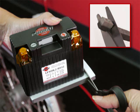So, in this case, we only needed to shim the height. Now let's trim the selected spacers to fit the battery with scissors. Also check the small picture at the top right. It shows a nice install tip. You can cut small sections from the 5mm foam pieces to the same size as the terminal nuts and stick them on the nut bottoms. This helps keep the nuts in place during install and up high where they can catch the bolt threads.